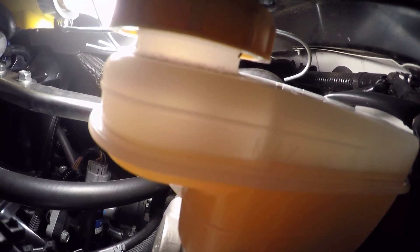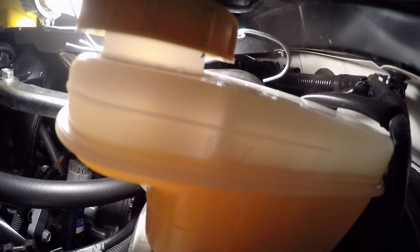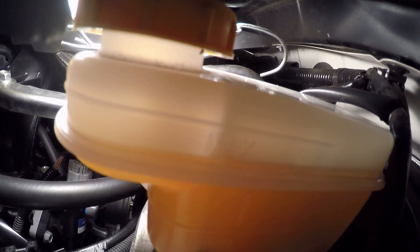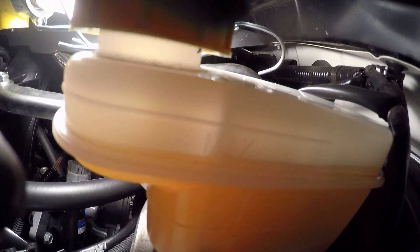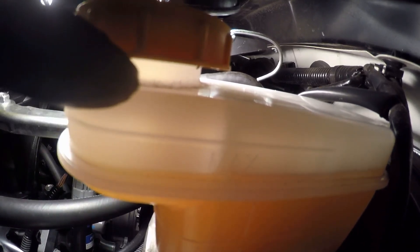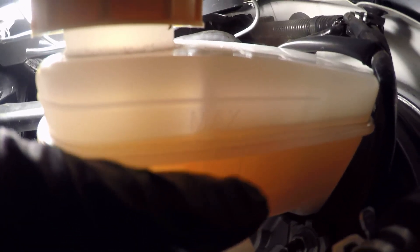Just so you know how much fluid you lost — I never touched the reservoir. It was about halfway, closer to the max line before, so nowhere near any kind of problem. You shouldn't even really top it up, because when your pads are fully worn and you push in the pistons to install thicker new pads, there's a lot less space. If you've been filling the reservoir throughout the life of your pads, when you push in those pistons you're going to overflow. The high-low margin on the reservoir exists so that when pads wear out at the bottom line, pushing the pistons back just brings it to the top. Do not top up your brake fluid regularly as pads wear — it will bite you when you push in those pistons.